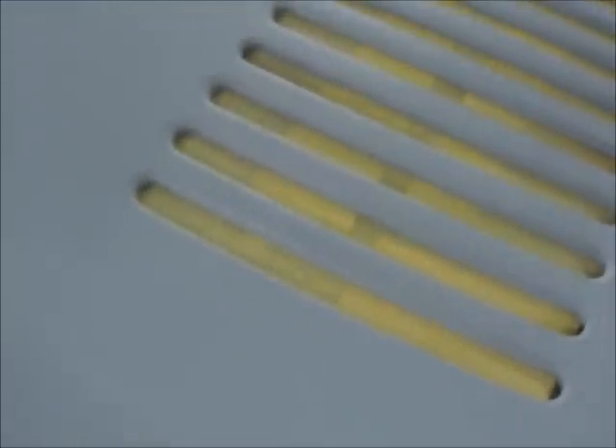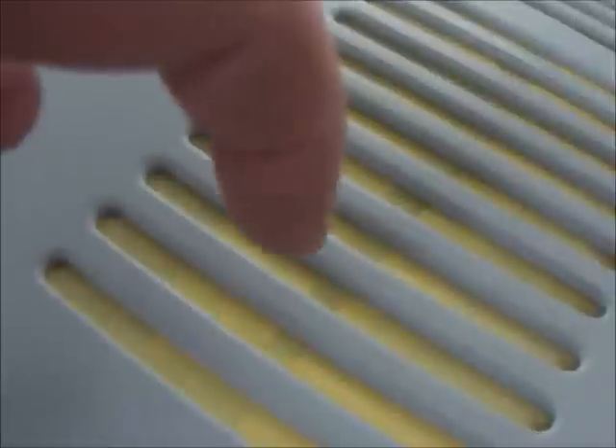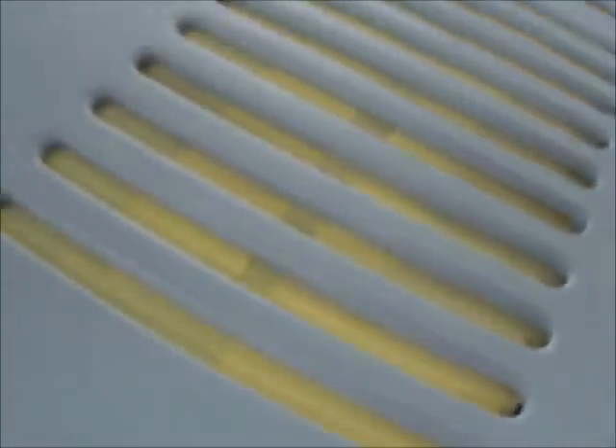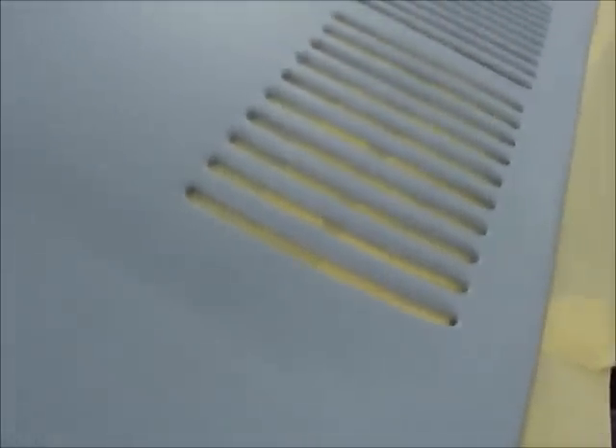It's tape time on the GTO. First thing when you get a back, mask these vents — clear coat is going to pull up in there and leave razor-sharp edges everywhere. I have to remember to push that out with a little tool right after I clear it, and try not to open the hood. I'd like to leave everything sealed up and masked for buffing.